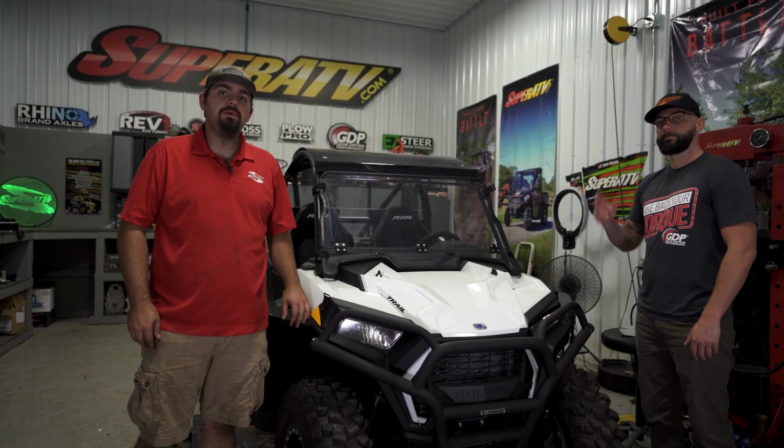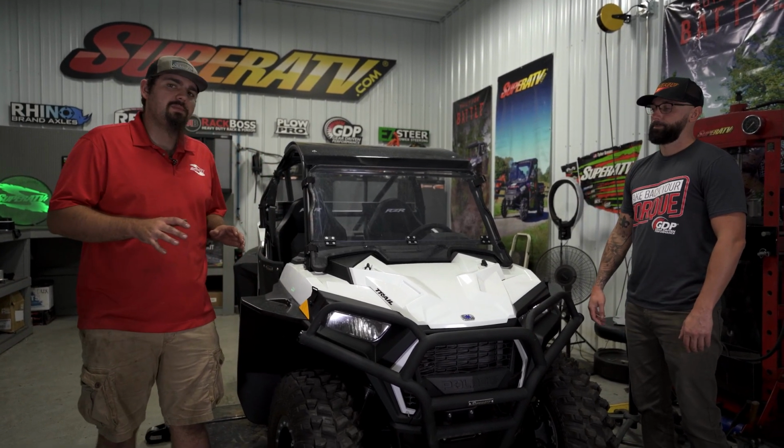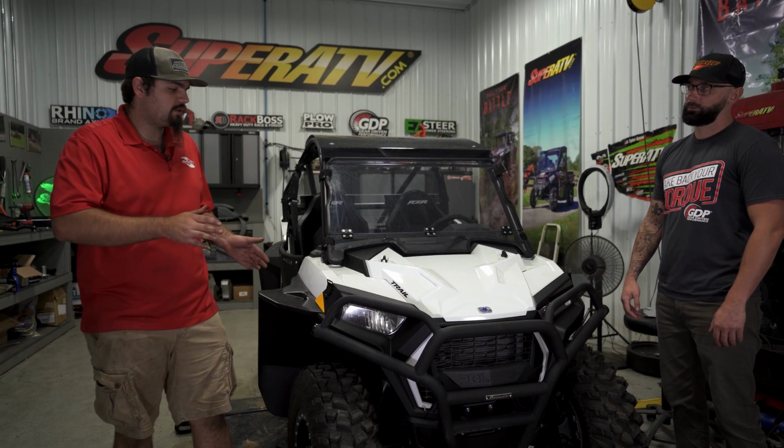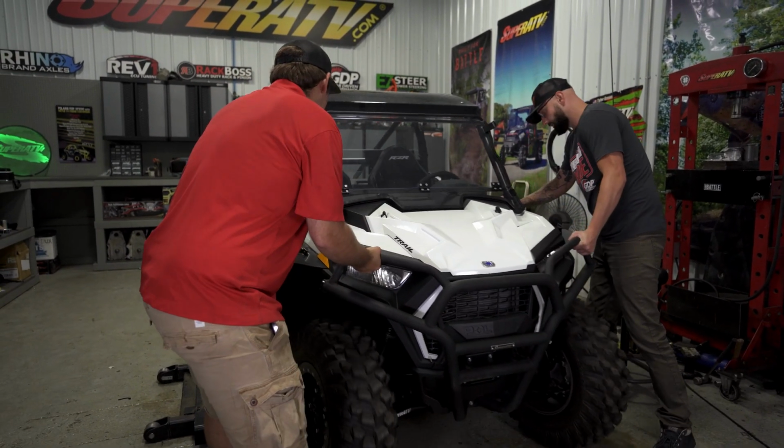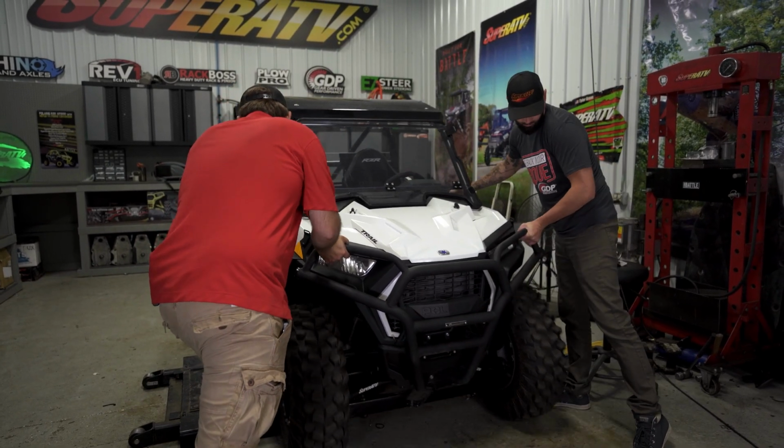We have Corey in here to help us. We're going to be settling the suspension before we set the toe. So we're just going to roll the machine back and forth about 5 times, cut the wheel both ways just to make sure our suspension is fully settled.